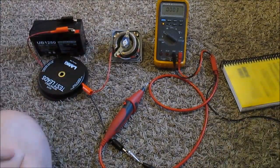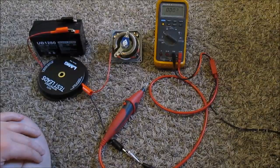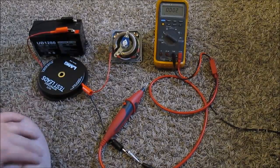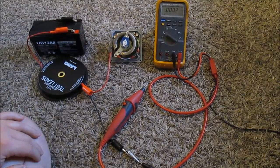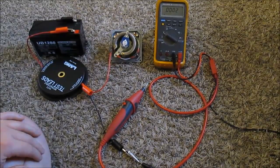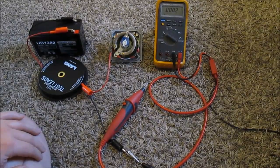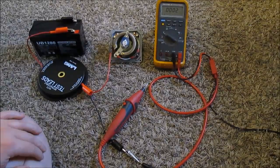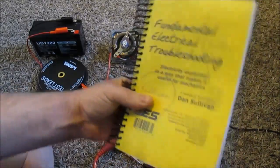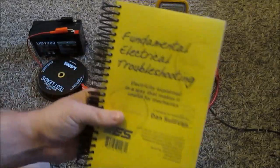Your meter reads the voltage drop and you divide that by your source voltage or static voltage. So basically you take dynamic voltage divided by static voltage and look at the percentage. You don't want any more than 3% to 5% max being eaten up by your wiring - better to be around 3% or less. Anyway, I think it's a great tool. I recommend it to anybody. And I think this is a great book too. Well, that's it.